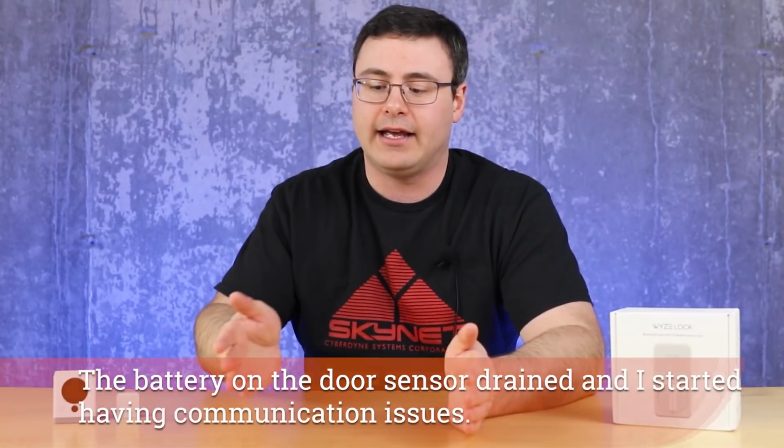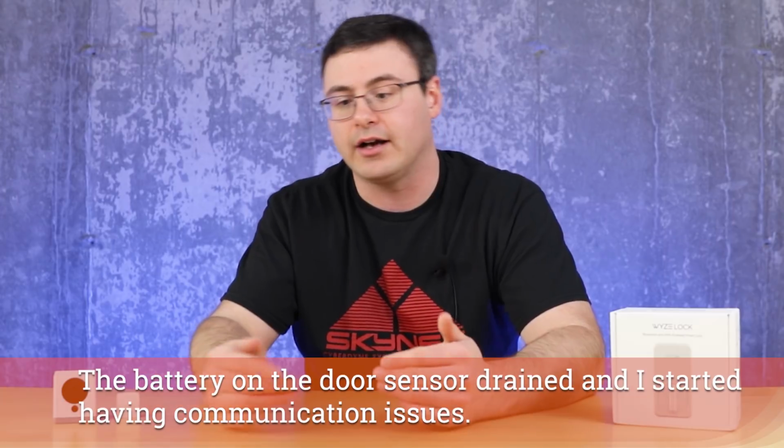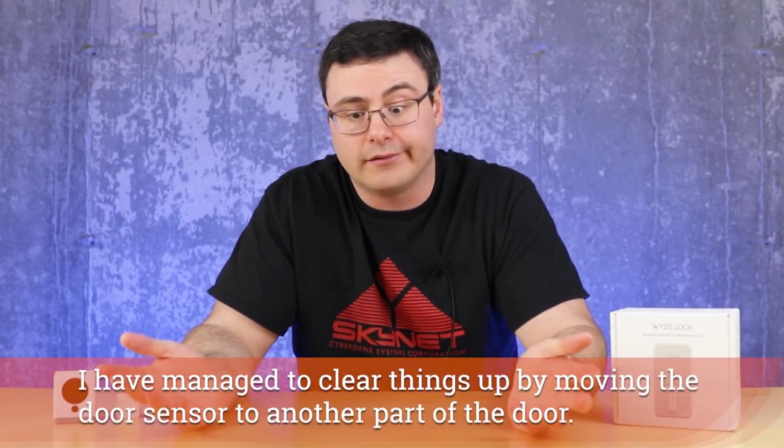And then number two, you cannot control the Zigbee channel on the Wyze Door Lock, and I instantly lost a door sensor over a couple of days because of Zigbee network interference. So this happened instantly to me, and this is going to happen to other people. If you can't change that Zigbee channel, and then your other hub, you can't change the Zigbee channel, and now you have devices next to each other, you've got a problem.